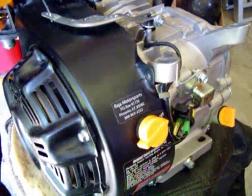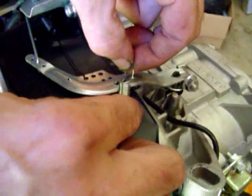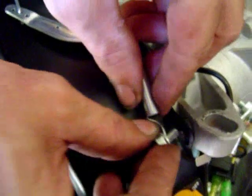On the forum I've posted some pictures of the springs that I used. Any lightweight governor return spring will be fine, such as this one here. This spring started out to be about that long, as you'll see in the pictures on the forum — I went ahead and shortened it down. It's real simple. Take one end and stick it in the hole there like that, and then the other end, which I've bent around to go around this bolt, is going to go in here.